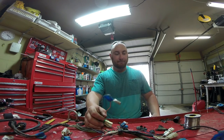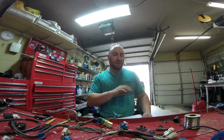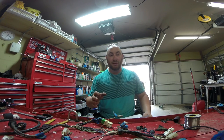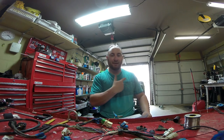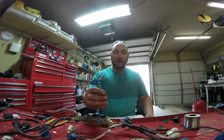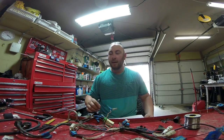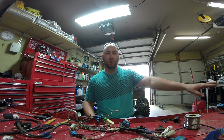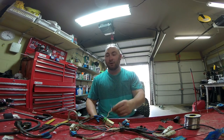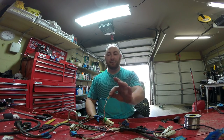Labeling gives me a checklist of things I need to do. There are two primary modifications you generally need to make: either move wires around because items are no longer where they were on the original vehicle, or rewire stuff completely and add new accessories — like we added the horn because the original ATV didn't have one. Right here you can see the wire that shoots off the coil — it used to be down here because the coil was mounted on the very front of the ATV, but now the coil is next to our ECU, so I traced it back through the loom and soldered it in the new location.